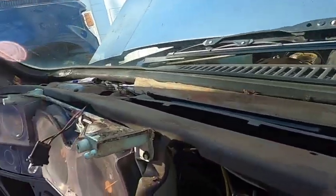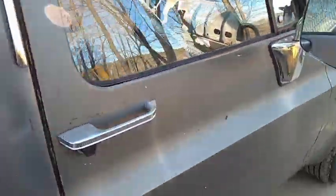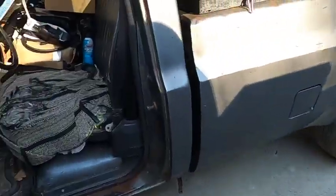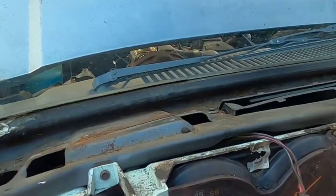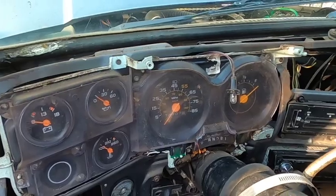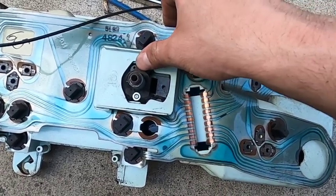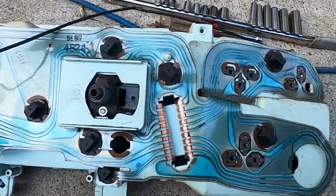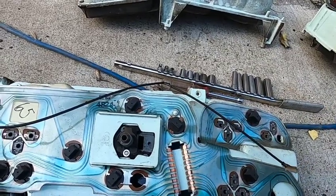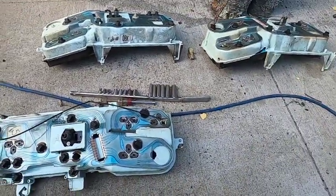The cool part is you get to find all sorts of nice treasures — somebody really liked this truck at one time. You might be asking what all this crap is in the cab. Well, as I work on the truck I order parts and I just throw them in the cab, so that way when I decide to really work on it I can just jam out on it and get it done. I vacuumed up all the nasties that were up in here, so now I just got to take these screws out and the gauge cluster will be removed. In order to get the dash out you got to pop the electrical plug and take the speedometer cable off, which is pretty easy — just push up on that little tab and that releases it. I have no idea what this thing is; I think it's like a little light that went to the ashtray. Might not work because that's burned up right there.